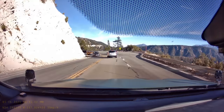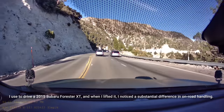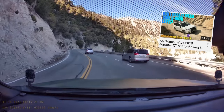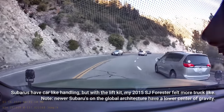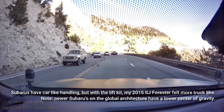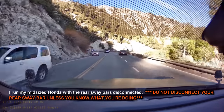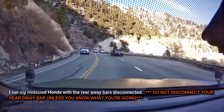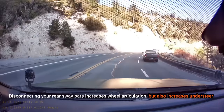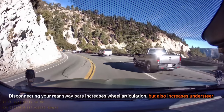Now there's a Forester in front of me. I used to drive one of those — a Forester XT 2015. When I got the 2-inch lift kit on that, I noticed a substantial difference. Subarus handle great on road, and you're gonna see that Forester leave me — I can't keep up with him. He's stock. And that's because I have my rear sway bars disconnected. I do this for ride comfort around town and for going off-road. When you disconnect your rear sway bar, you increase understeer.